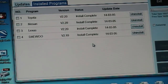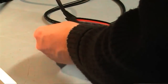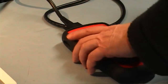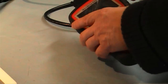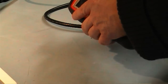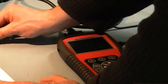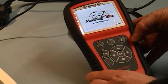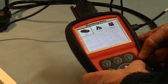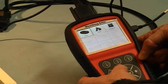The download is complete. You click up here and you'll see what programs you actually have installed on your SD card. You can uninstall any of them you want, or all of them. As you can see, I've got Nissan version 2.2 — this would not work on the Nissan Almera outside. I would have to uninstall that and reinstall version 2.10. I'm going to exit the program, put the SD card in the unit, connect the USB cable to the laptop, and the unit will power up.